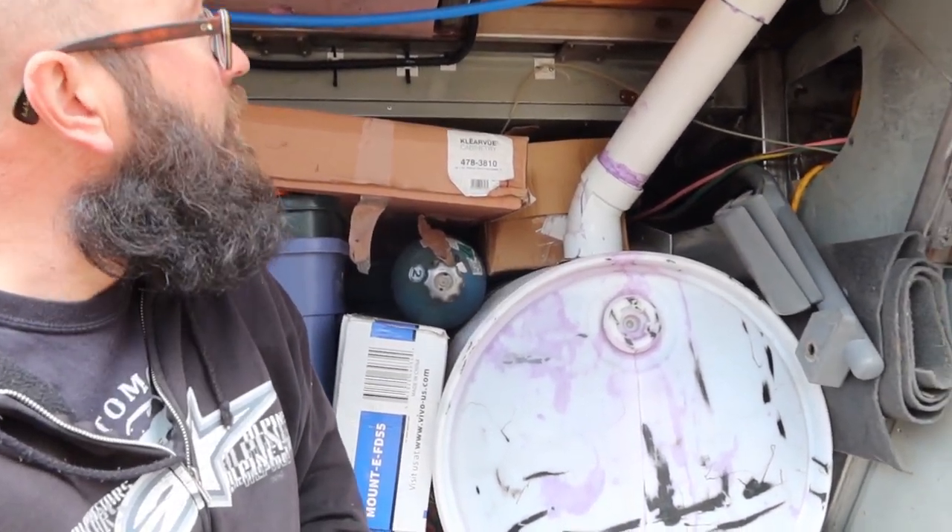It's really nice having a black tank. I still have to hook a vent to the black tank that goes up through the roof. Right now when you flush it, sometimes it burbles up smells into the bus. Not recommended — don't forget your vents. The vent still needs to be installed, hopefully that's next. But the tank part of the tank works, and it's been two weeks now and it's time to dump it. It worked great.